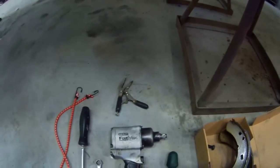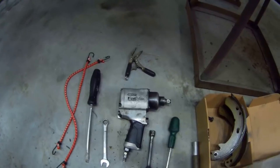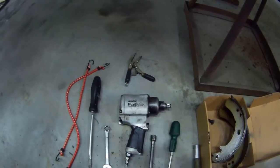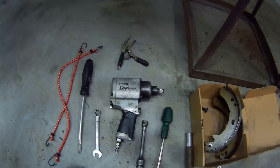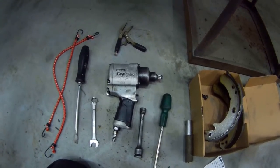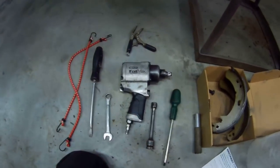A pair of needle-nose vice grips to try and get the handbrake cable off. Now, there are two different types of handbrakes and transmission brakes on these 110s and 90s, and this same applies to some of the earlier Range Rovers and Discoverys. On the earlier Defenders, it was all done by a cable and a lot of linkages that went on the side of the transfer case — those are notorious for rusting up. So if you're going to strip this down, take it all to bits and grease all the pivots, all the joints, all the pins, take them all to pieces, grease them up and put them back on. But this one, fortunately, is one with a full cable adjuster operation.